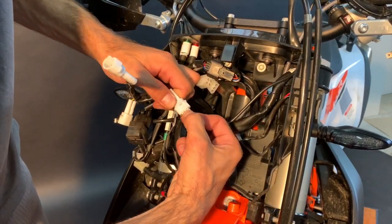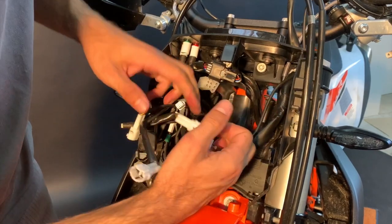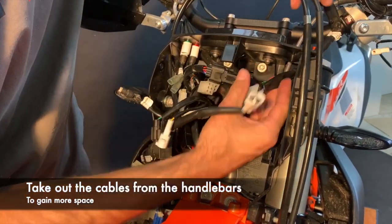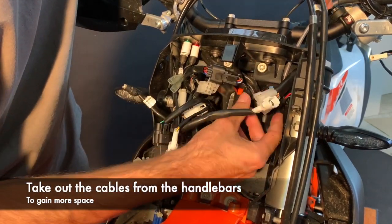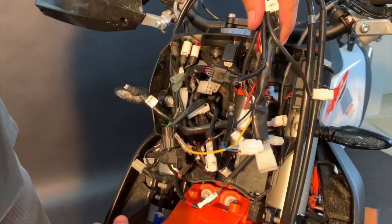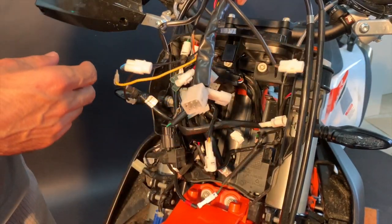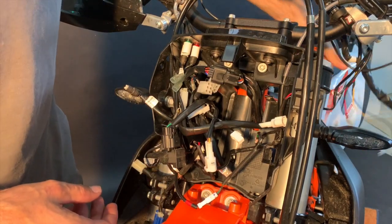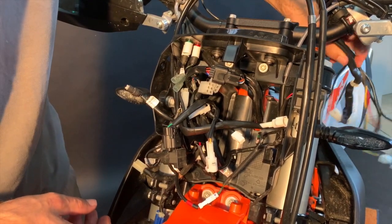On the right side there is one more cable coming from the handlebars — take it away. Now it's easier to get out the six-pin and the three-pin. Now you see all the cables from the handlebars are out, so you put them over the handlebars to give yourself more space and avoid getting confused with the other stuff.